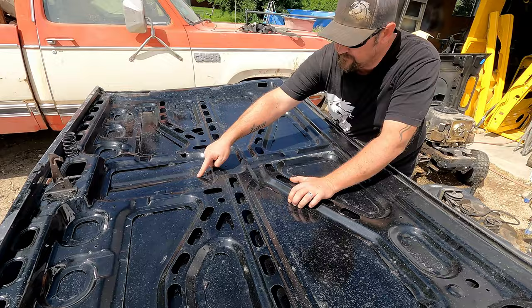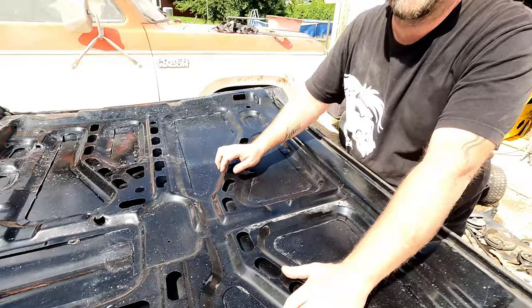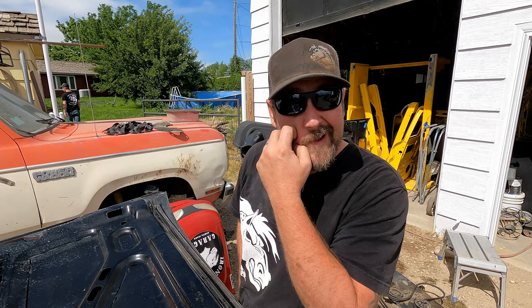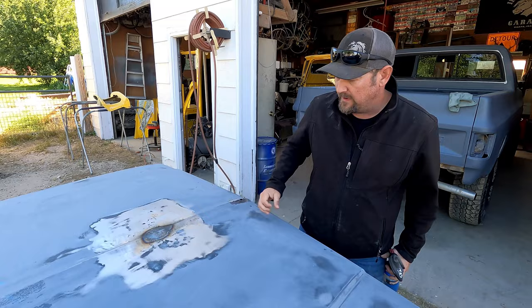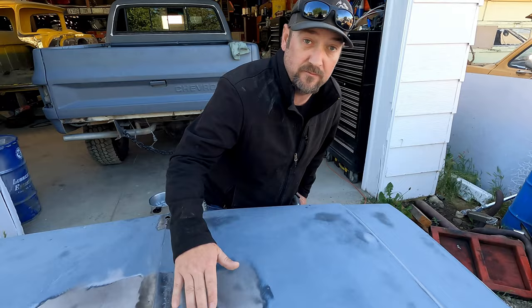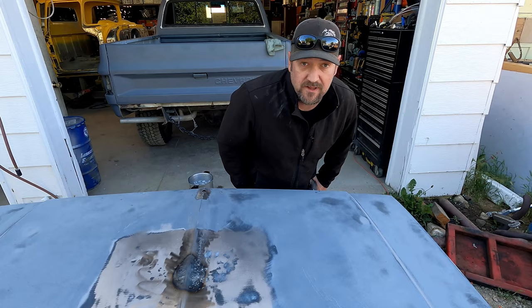What I've got here is the hood for the square body — somebody welded in a crude old patch and it's actually concaving the hood. We're going to cut that patch out, put a new patch in the proper way, and probably heat shrink the hood to get strength back in that area. We had a big concave dent right over the body line in the hood and you can see we've already started to heat shrink it — done it a couple of times, it was really bad. We're going to do it one or two more times.